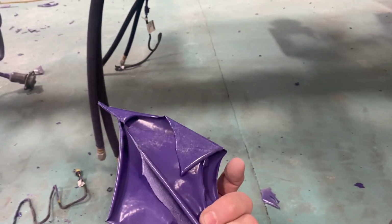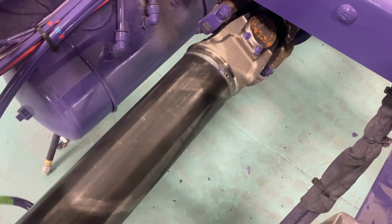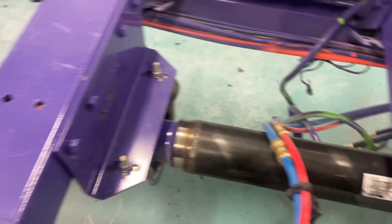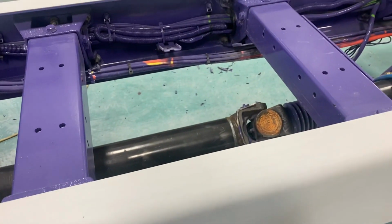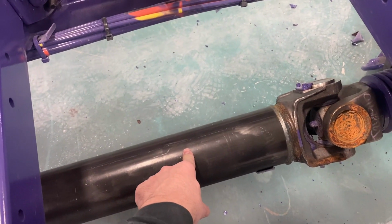So if you look on the floor, there is paint chunks. And when I mean paint chunks, I mean paint chunks. What they are off of is the drive shafts. So if you get around all these yokes, none of the paint sticks. And for most of you, you've had this. And I'm gonna tell you, before you go ahead and paint these, please, please, please blow the paint off of this, and I'll show you in a minute here.